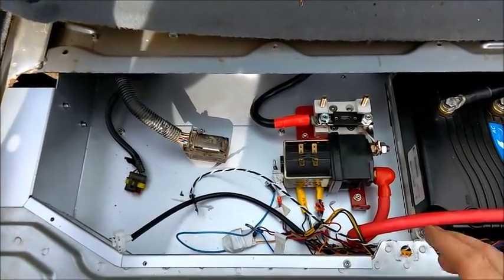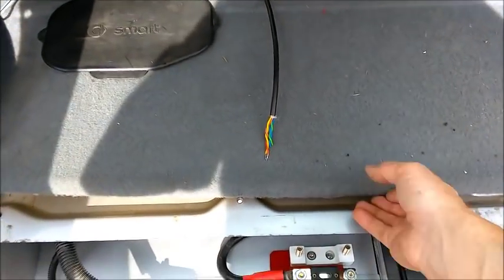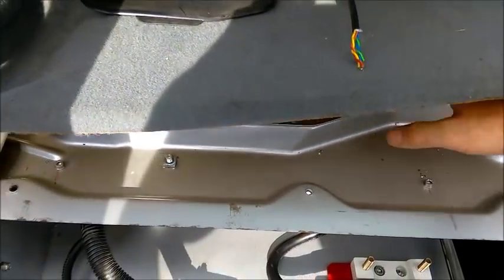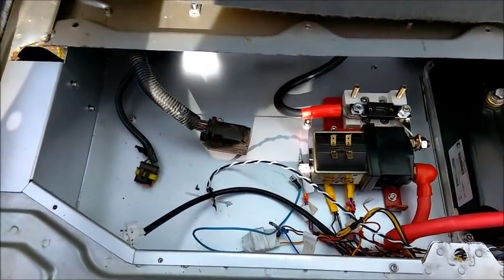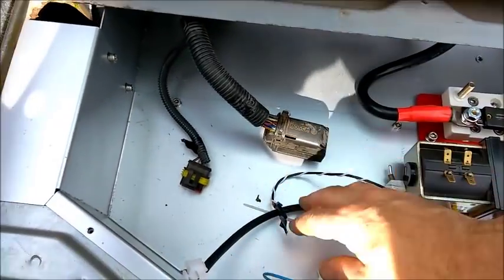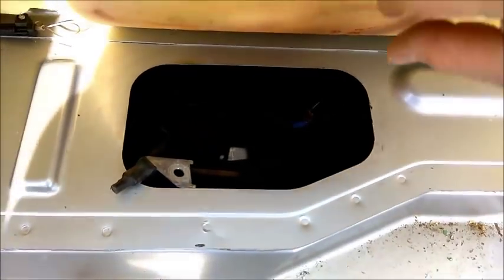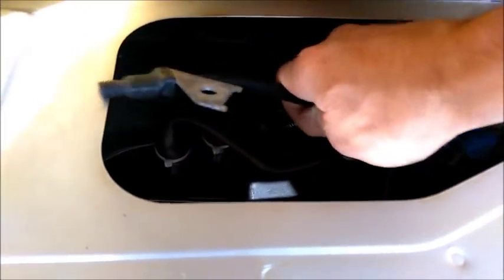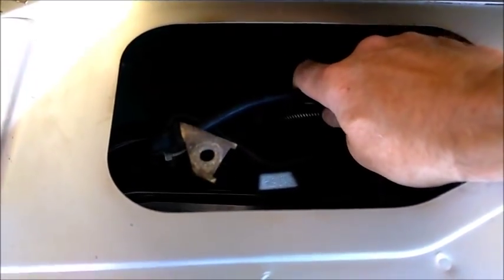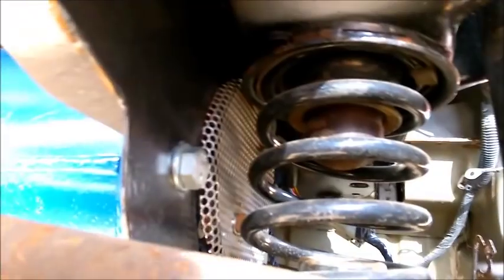The other thing I need to do is get the charge controller, which I haven't got yet, but I'll probably mount that underneath this plate where the fuel tank normally is. I also need the 12 volt battery — I've put the other batteries in the front and I think I'll put the 12 volt battery in the back here. Rather than use up this space, I might use this hole that's standard in the Smart and get the battery mounted down in here. This is the old alternator cable that comes from the front, so I can use this to get everything onto the battery and then take the 12 volt system back to the rest of the car.